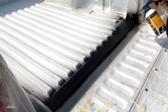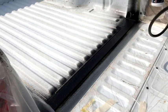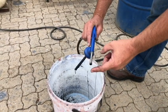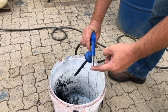If your stone chip gun gets a blockage, remove the container, put your finger over the nozzle and with one quick burst blow the blockage out through the bottom pipe.